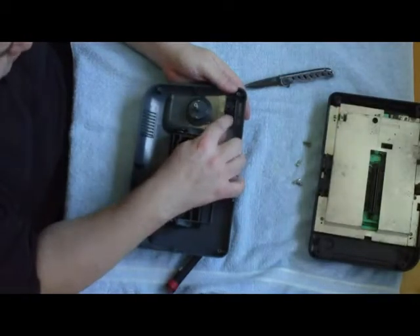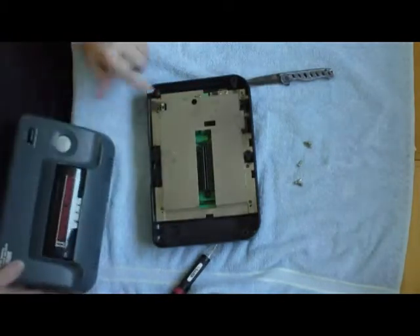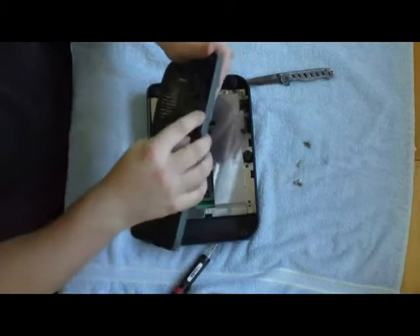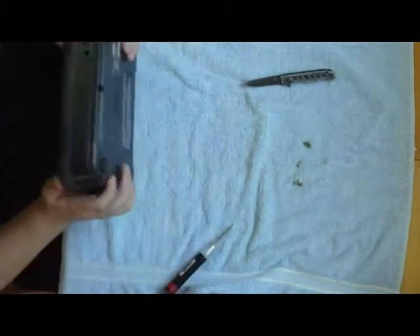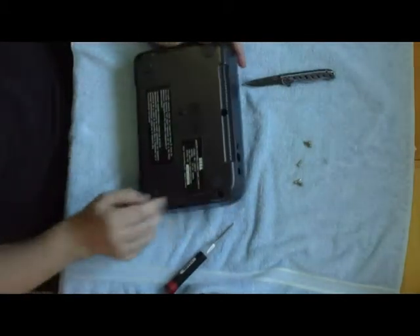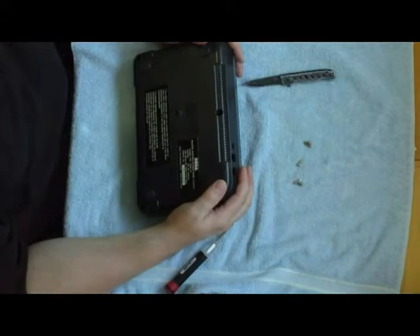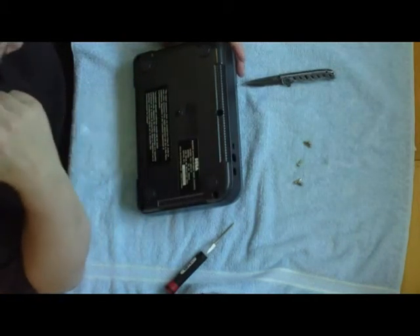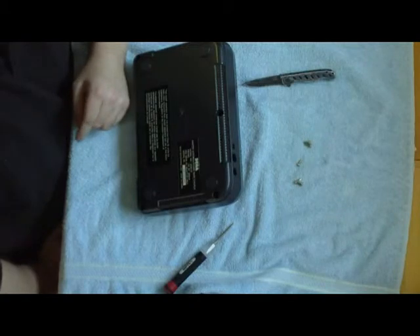Go ahead and snap it in past those four posts. Remember where your power position is — you want it all the way to the left so it's on/off. It's got two little lips right here so you put it in front first and then down, and that should slide together. If not, you put it together wrong, but if you follow these instructions it should slide right on. Flip it over, replace your five screws, and you're done. That is my tutorial on how to disassemble and reassemble your Sega Master System 1 or 2. If you like this video give it a thumbs up, subscribe, and check out our Amazon store if you need a retro game or movie. Thank you very much and have a great day!